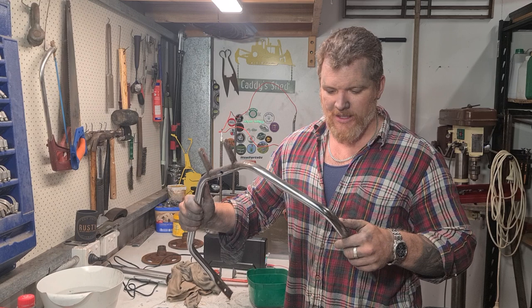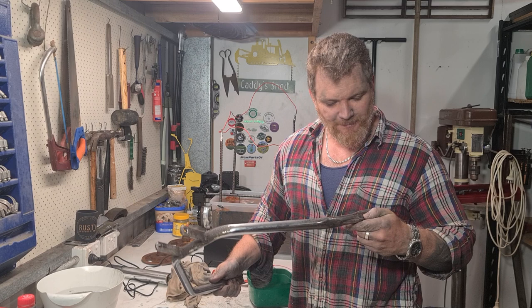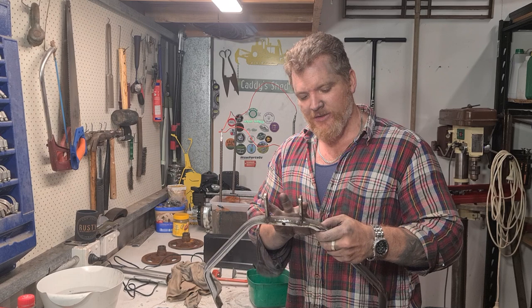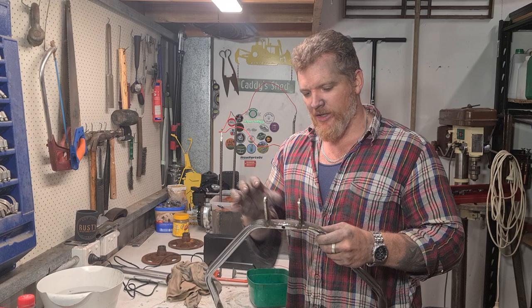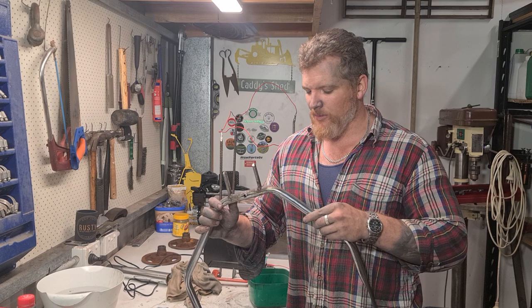It's pitted to a point where the chrome is right back down to bare steel, so unfortunately these are probably going to get stripped and painted. Having said that, I haven't done my third methodology yet, which is going to be quadruple-zero steel wool with penetrant. Every now and then I've been giving this end a dose with penetrant because I want to hit it with the steel wool and see how we get on. This is a little bit finicky getting in around here. These bars are cactus — they will get painted. Or you could consider a stainless steel option if you still want that chrome look.